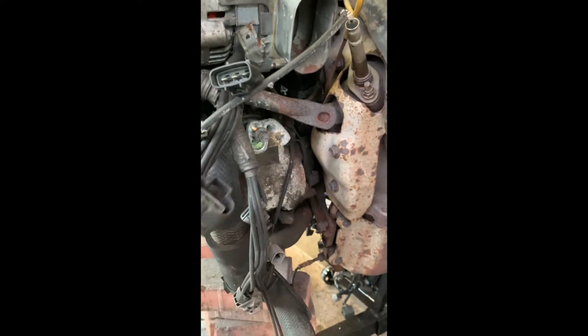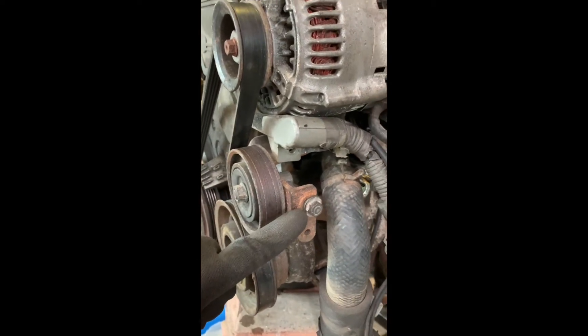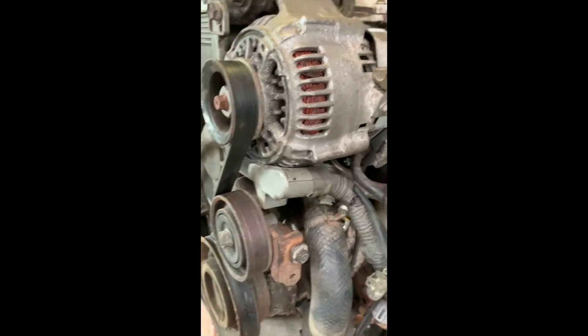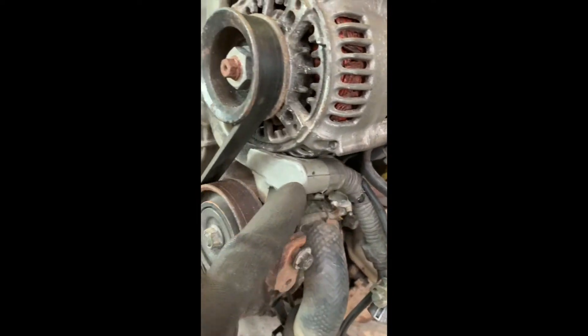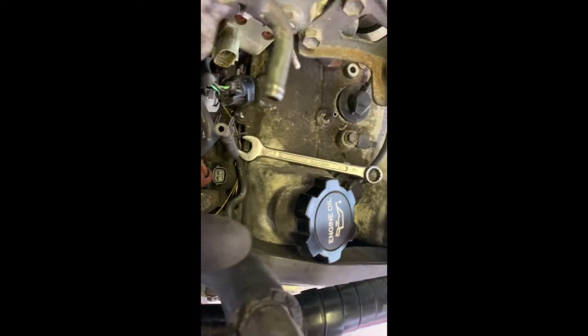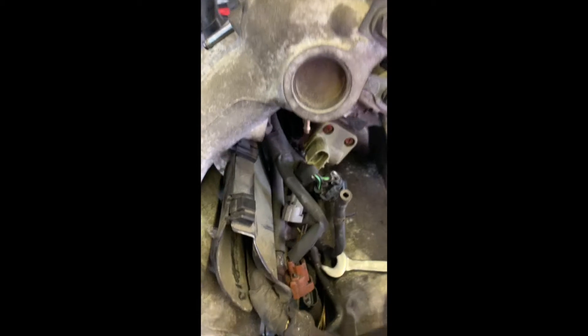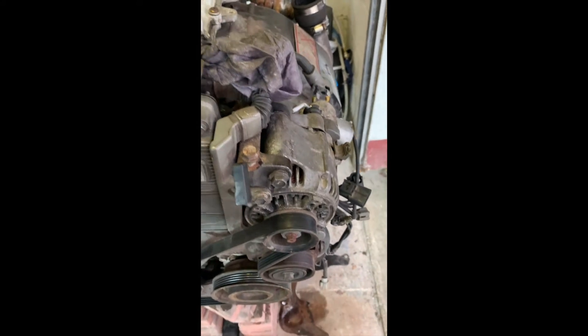Here's another challenging bit — I've disconnected the oxygen sensor. There's more wiring loom down here running around to the aircon. I'll have to take off the alternator tightening bolt and loosen the belt to slide it off the alternator. All of this wiring loom goes through a plastic cover, secures on the side of the engine, runs across one connection under the alternator, and then into there under the manifold. Now that the manifold is wiggled loose, we'll have to go in reverse and free all of this before we can get the manifold off.